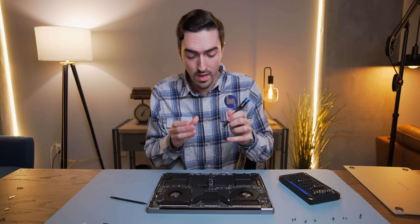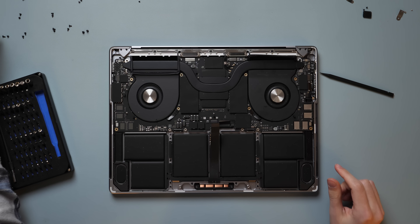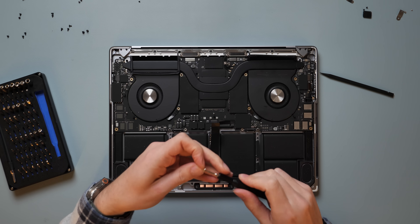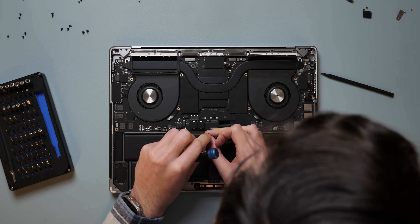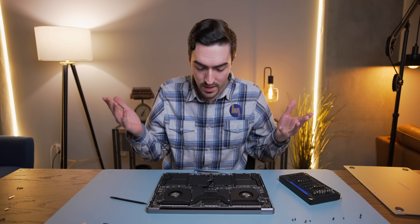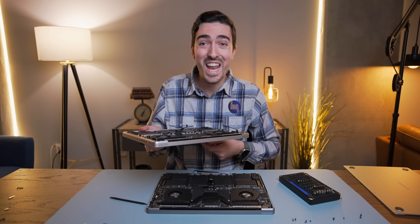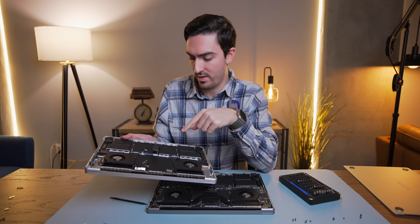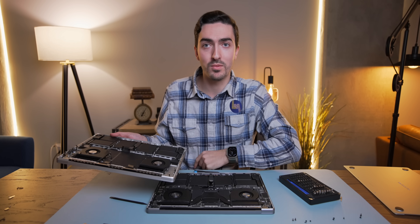We want to save the battery for last, and I'm just going to give this guy a couple of screws — I don't really see the need to do the whole board. There's one more: this absolutely microscopic little flex cable. I really hate these things because they are so fragile, and if you break one they're screwed into the top case — new top case. The trackpad connectors are different lengths, so the trackpad on the M1 Max does not plug in to the M2 Max logic board.